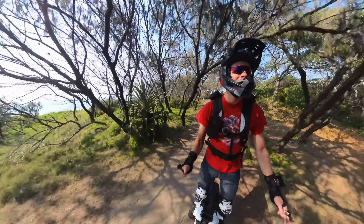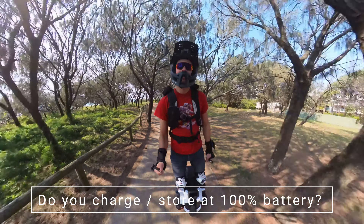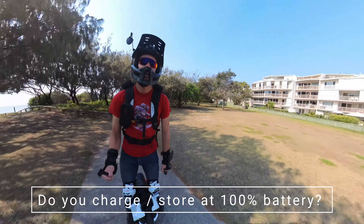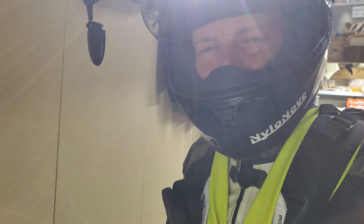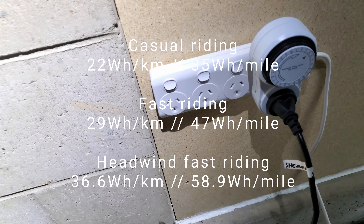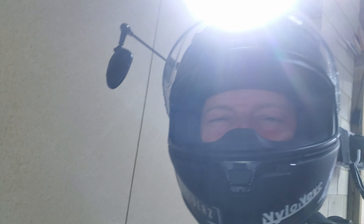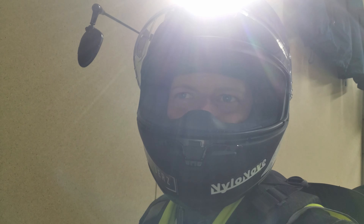Community question one: do I charge the Sherman S to 100%? Only if I'm going riding the next day — otherwise I'm happy to leave it between 70 to 90%, which is the sort of storage charge you want to give the battery the best chance. For example, after a ride on 40% battery, I'll use a timer to start charging after about half an hour to let the battery cool, and set it to about three hours to get up to around 90% ready for tomorrow. I balance it every second or third charge cycle.